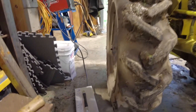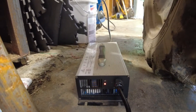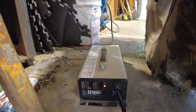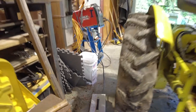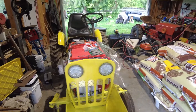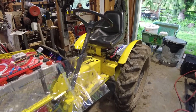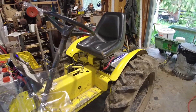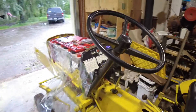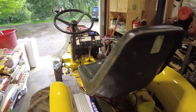I started off with a smaller charger, but I decided to go with this big boy — it's a 20 amp charger, because the 3 amp charger just takes too long. Say you ran out of power, you wouldn't want to take three days to charge it. It actually charges in like an hour and a half now, so I can stop at lunch and come back with a full charge. I have yet to even bring it down below 75 volts, which is pretty amazing.